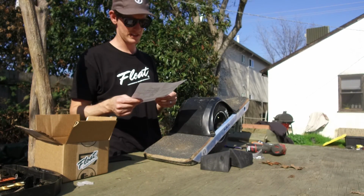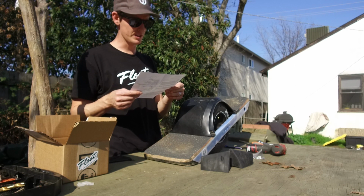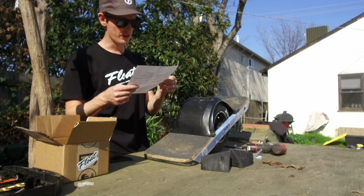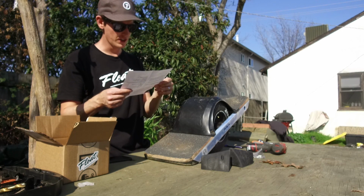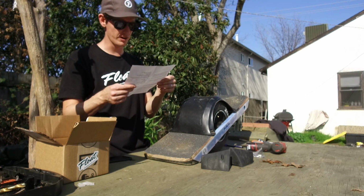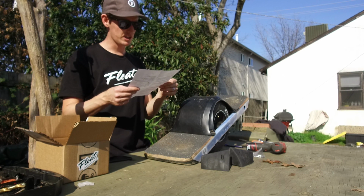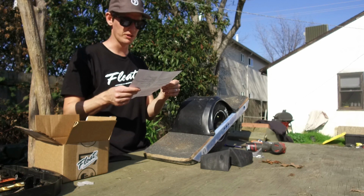Alright, step 3, finding the mark. With the fender still attached to the board, place the Onewheel in front of you and hold the fin up to your pen marks. Notice that the fin may be slightly askew, as you just want the best fit. It's okay if your fin is not parallel to your board. Take the 3-inch nail and scratch into the painter's tape for each of the 4 holes, making a strong mark to use when you drill. Do not drill with fin attached.